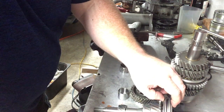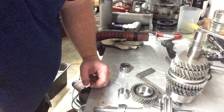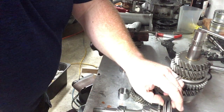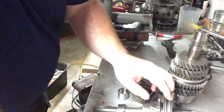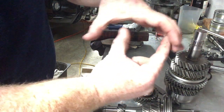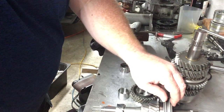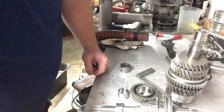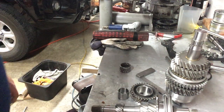I think I am starting to really prefer the 091 keys, even though the keys become the weak link. I think you get a better shift quality. Someday it might be interesting to try the 002 version hub, and I haven't researched it enough to know if the 002 slider could be run with the 002 keys in an 091, just so it immediately starts pushing those keys. Otherwise the 091 slider has a lot wider cutout, so you get a lot of sloppiness — it doesn't have a very clean neutral feeling. The slider kind of pops around, but with this one you can tell the slider wants to stay right where it's at because the keys are the same groove. The fork would hold it still, but it still feels a little better on the bench, and I'd assume even driving with the 091 keys in there.